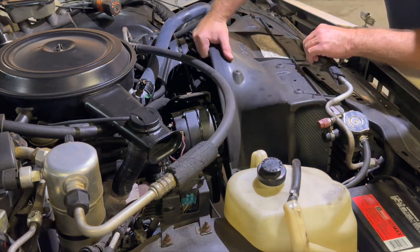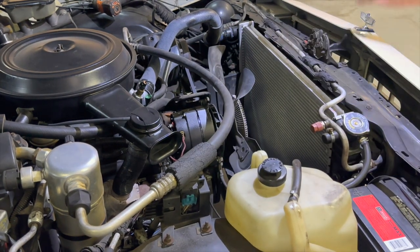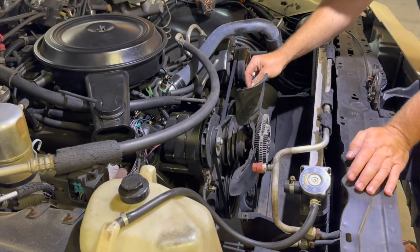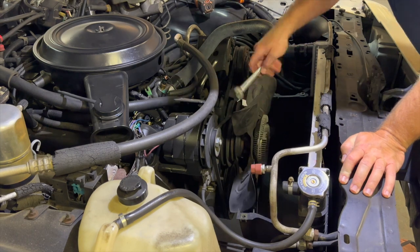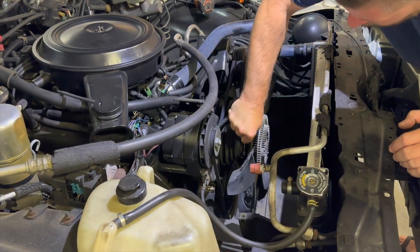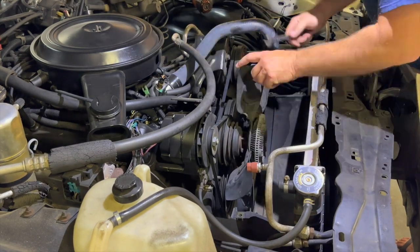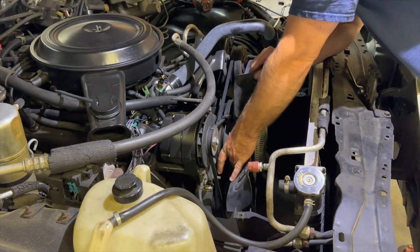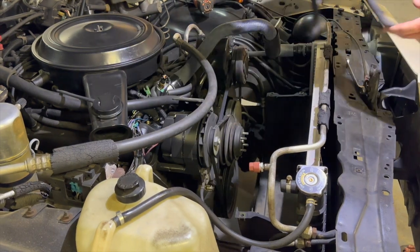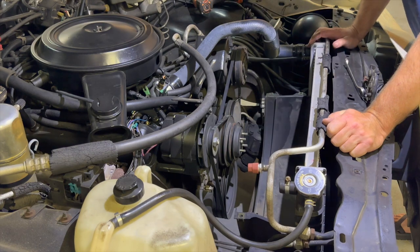This might be a little tricky. There are four studs on the water pump with nuts on them holding the clutch fan on. I'm just going to take the clutch fan off and place the nuts there. So we can't do just the nuts back on it — there's a shoulder on the stud, so we'll get some washers for that. The shroud is out. So we've got the fan off and the new fasteners.